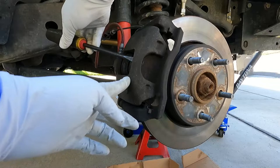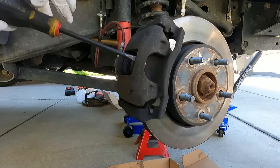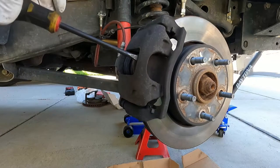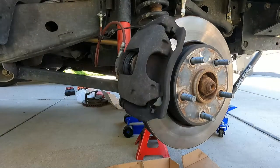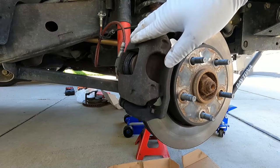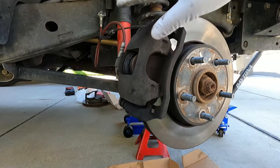If you're not changing out the brake caliper, what you'd typically do is just get a screwdriver in here and pry that caliper piston back in. Of course we're not going to try to save this - it's blown out and we're just going to replace it. These should be replaced in pairs, so even though only this one blew out, we're going to swap out both calipers.